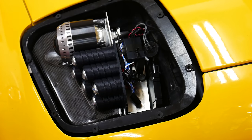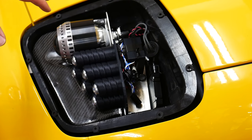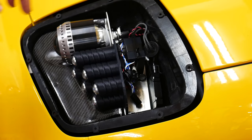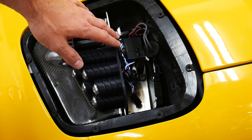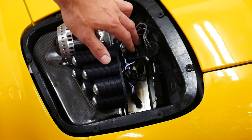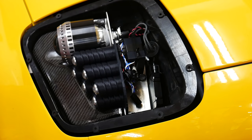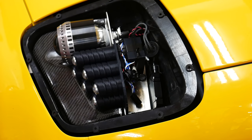All right, so now that the projectors can no longer rotate and they're locked in, I've put the assembly back into the housing. As you can see in the back, I've cleaned up the wiring as well. Just used some cable ties to tie everything down and keep things neat and tidy back there. I also took the PCB box, put the lid on, sealed that shut, so no water should be able to get in. And we're pretty much ready to aim these things one final time, make any minor adjustments that might be necessary, and then we can pop the lenses on and see how it looks.